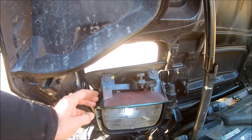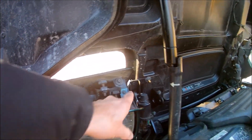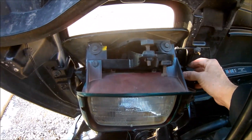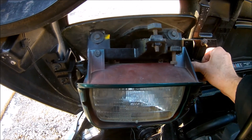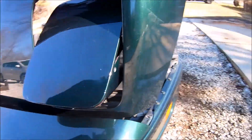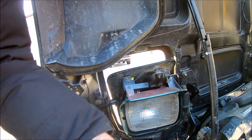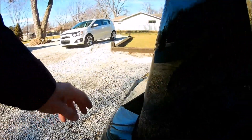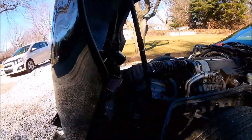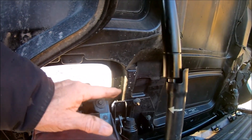You can see there's an adjustment because the lid just slides over the screw — either down or up. Mine was down too far. To fix it, you can't get to the bottom bolts without taking the headlight cover off first. So I had to remove this bolt and this bolt, then rotate the assembly by hand right there, take those two screws out, and the cover lifts off so you can get to the bottom bolts.